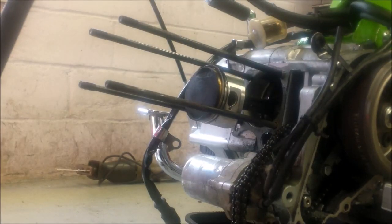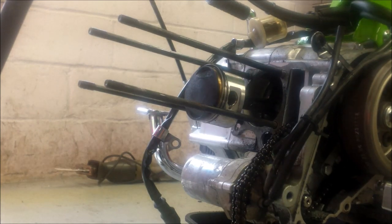There's the cylinder removed - all that's left is the piston sticking out. To remove that there's a wrist pin clip on the other side. Take a pair of needle nose pliers, give it a twist to release the compression on it, pop the spring out, get the wrist pin out, and the piston will come off.